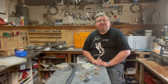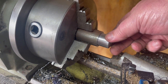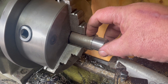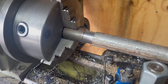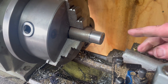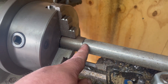What I did was buy a slug — 100 mil of inch and three-eighths round bar — because the inlet of the silencer is inch and three-eighths. So I can just cut the old exhaust out and weld this in. Of course I'm going to bore a hole up the middle. This is the piece of exhaust pipe I have; it's got an internal diameter of 28 millimeters, so I've taken that down to 28.2 and it slides over nice and easy.